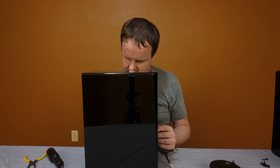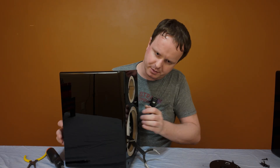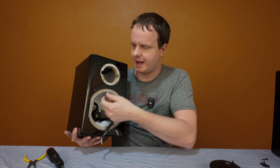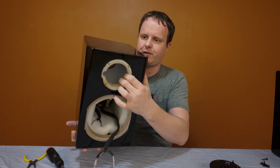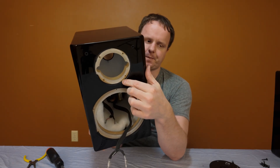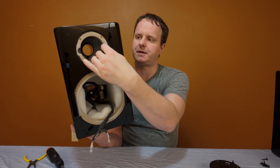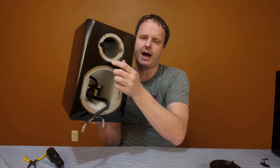There's no cross-bracing whatsoever. Now that the woofer and the tweeter are out of the speaker, it does sound like it could use maybe a tiny bit of cross-bracing — maybe for the Prime Evolution series they could have a cross-brace that's a plus-sign shaped piece of MDF going from side to side and front to back, which would add rigidity to the cabinet. I do notice a very thick front baffle on this speaker. Considering it's already routered out so that the tweeter and woofer are recessed by maybe three-sixteenths of an inch, the actual front baffle itself feels like it is at least a full inch not counting that routered-out area.